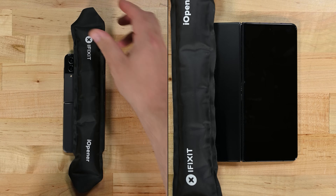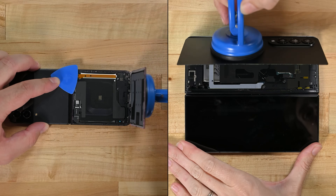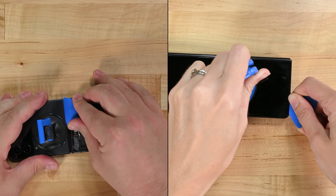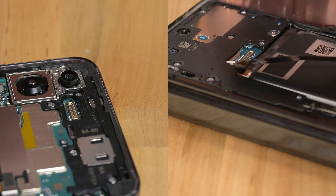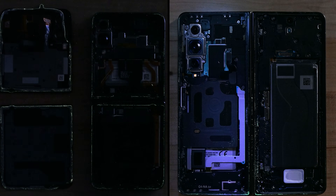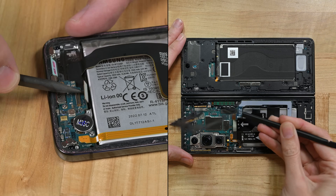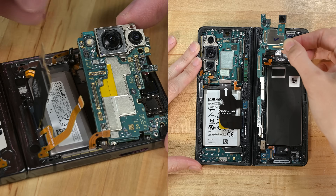First off are the rear panels. Heat, prying, a bit more heat, and a bit more prying, and away we go. The exterior screens give us way more trouble. The adhesive may be thin, but it's tough. This glue is working hard to keep ingress points all walled off. Our first look at the insides shows that most of the dust gets trapped in the adhesive and on gaskets like the SIM tray, keeping the guts surprisingly clean. Speeding right along through charging coils, cables, screws, and protective covers, plus even more connectors and screws — and bye-bye boards.